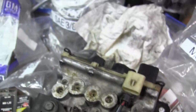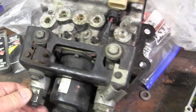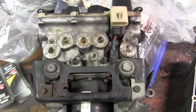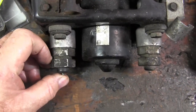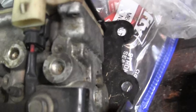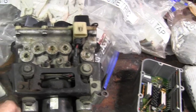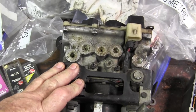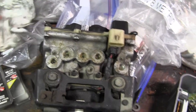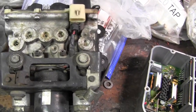I need a new camera, but I'm going to use this one until it completely dies — it's half dead already. To bleed these things, you bleed the brake system, then you've got to bleed the ABS, because the first time it activates you'll get a spongy pedal unless you bleed it. It's got these little clips that go on the towers to depress this pin, and there's a special bleed procedure. The best way to know how to do that is there's a video that General Motors did for their service technicians back in the 90s. This unit was used on a very large number of vehicles, so you can find some in salvage yards to pull out and see if you can bring them back to life. They're worth a lot of money if they're operational.